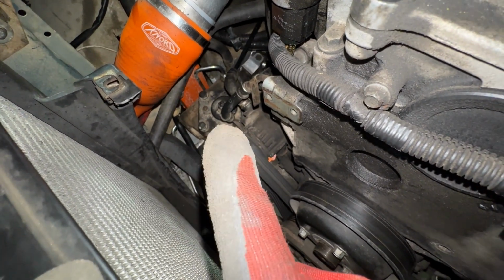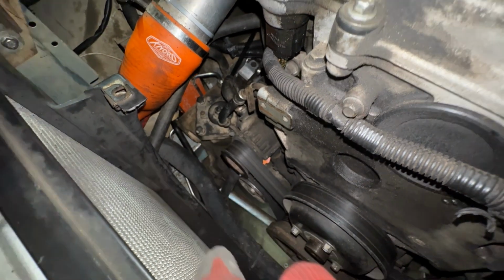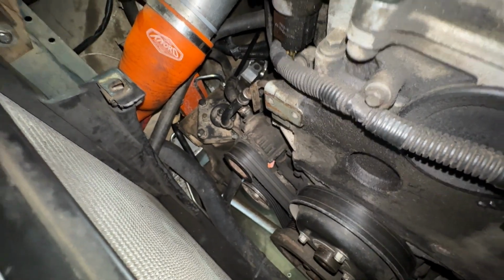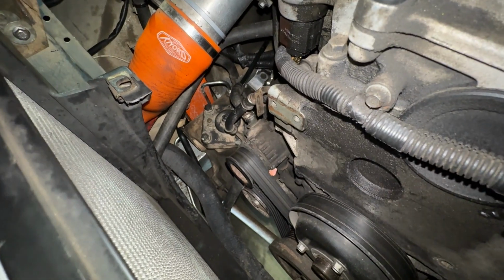I've also done the underneath. That's completely clean. I think it's coming out of the lower end where the drop arm comes out, because the outer seal, there's about 3 seals on that, the outer seal is all cracked and perished, and it's a bit damp.